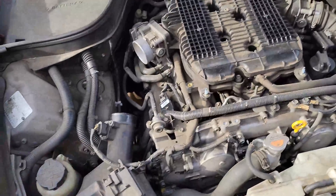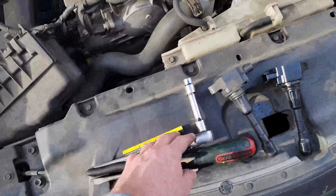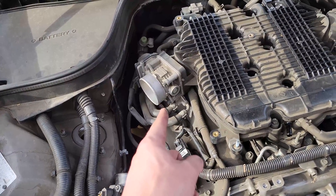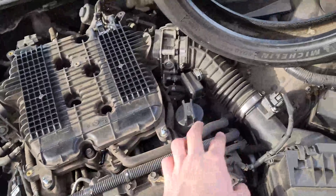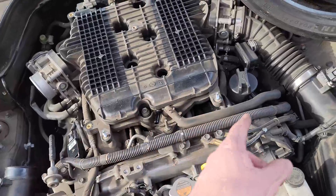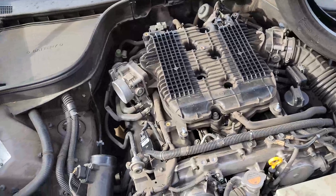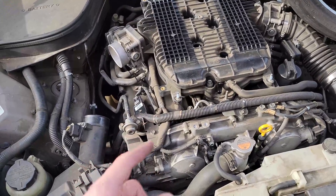If you have a single cylinder misfire, this is a really easy problem to fix by yourself. For most of the cylinders, all you need is the 10-millimeter socket. If you do have to take off the throttle body, that might be a little more work to get to the other cylinders. The engine is pretty symmetrical, so if you just need to get to cylinder one or two, it's really easy — just take off a little bit of the boot. If this video helped you, please like and subscribe. It helps the channel a lot.